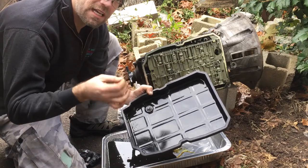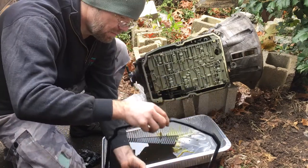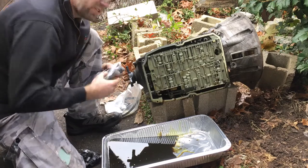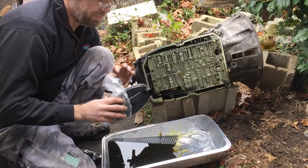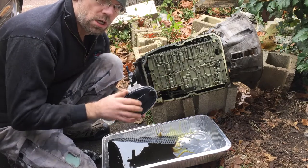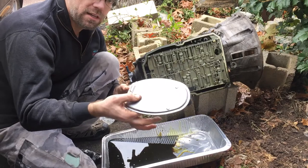You don't have to add an extra magnet, but I like a little extra precaution. Once you clean the magnet and the inside of the pan, you're going to take this, which is called the gasket. Right here is the filter — this is actually the new filter. It's very different than other filters I've seen — it's flat. A lot of canister filters for oil or inline filters for fuel are round, but a lot of transmission filters are flat, as you can see.